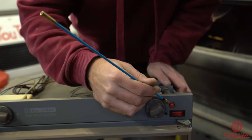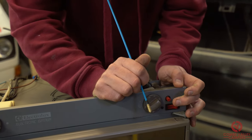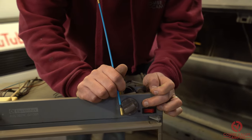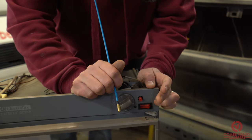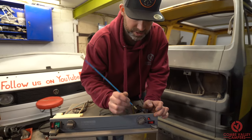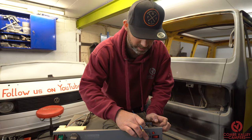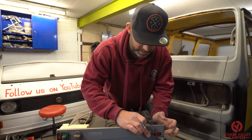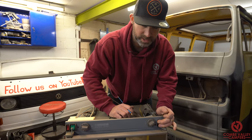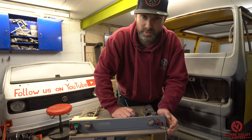This dial over here controls the gas — again, zero is off and you can crank it all the way up to eight which is the maximum. On the left is your gas hold-down switch: when you're trying to light the gas you hold this down, turn the igniter switch, and once the flame is lit you release it. It's much the same as your gas hob at home. In fact, later versions of these fridges incorporate the valve into the dial so you push it in and ignite. On this older version there's a separate button to push down and then activate the electric igniter.